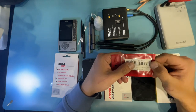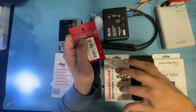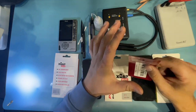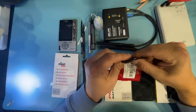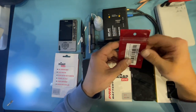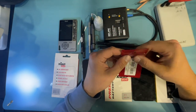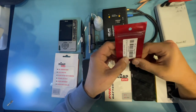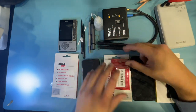What Injured Gadgets has developed is a solution where this tag-on flex is pre-programmed to 100%, so as soon as we connect it to the cell and the original BMS, we boot it in a specific way. You must boot the first time with the lightning cord, not the power button. That first boot gives us a battery message, and then the second boot adjusts the battery health.